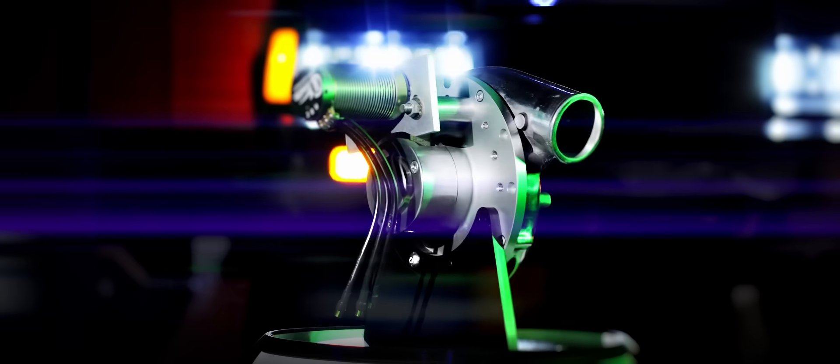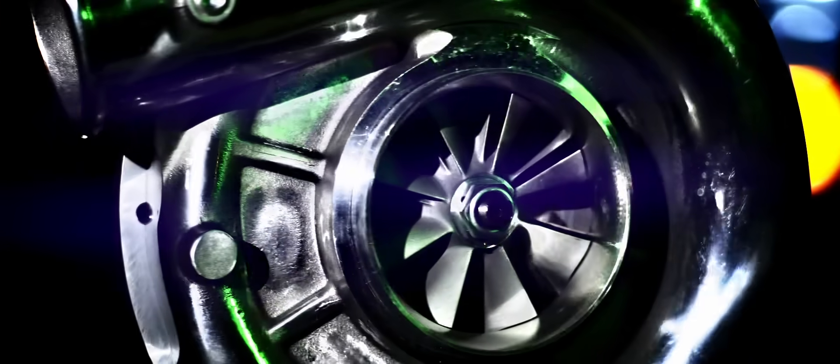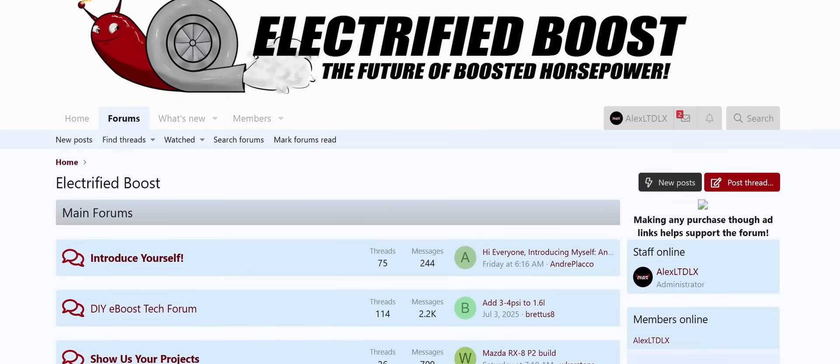It's been a long time coming, years in fact, but we're finally at a point where we can dyno test the cheaper, easier-to-assemble electric supercharger that makes more financial sense than the sledgehammer does. You can replicate this thing for about $1,500 to $2,000, depending on how fancy you want to get. If you have specific questions, join our forum at electrifiedboost.com. It features a Castle 2028 RC motor, a Hobbywing Max 4 ESC, and a Speedmaster centrifugal supercharger. I'll put links to the parts in the description below.